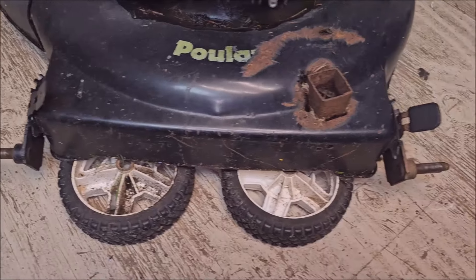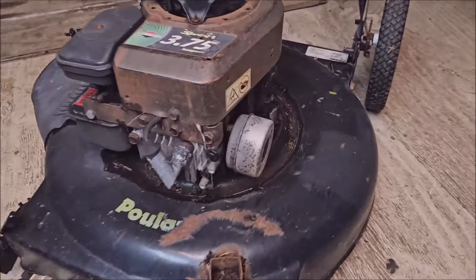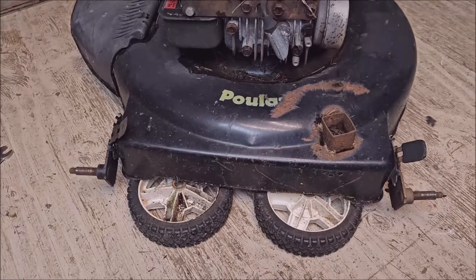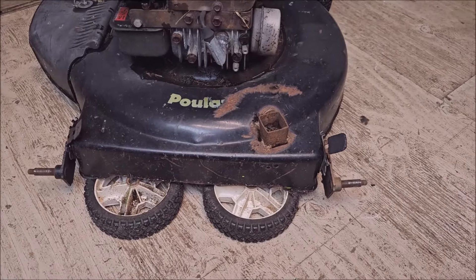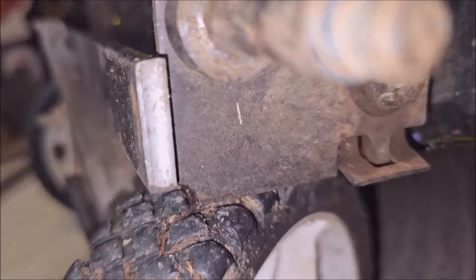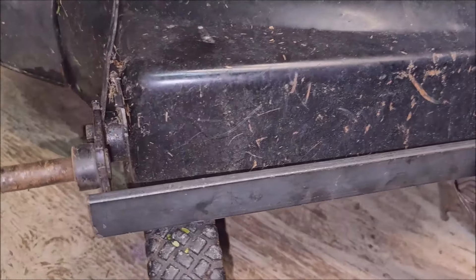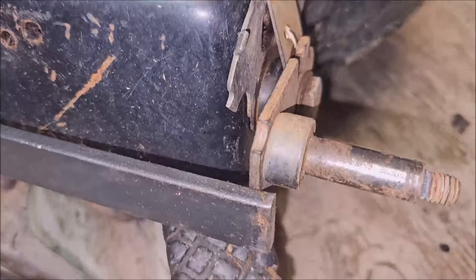Let me get a piece of metal and we're going to weld them two guys together. We'll still be able to adjust it. Got to make some repairs to them wheels, and we'll see if we can get the old Poulan lawnmower to go a little bit more for us. I got about one more year. Most people would have thrown this in the trash, but let's see if we can keep the old guy going. Let's get some work done. There's probably several hundred different ways of doing this, but I got a piece of one inch by quarter inch hot roll clamped up there. I'm going to position the old dude about right there on this bracket. It ought to clear everything. We'll be able to continue to use the existing height. Let's weld old guy on there and just keep on mowing.